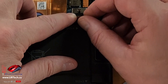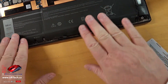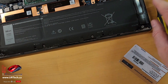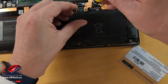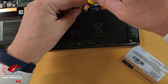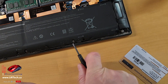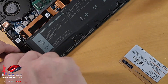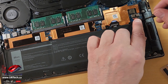Now let's plug this connector in. Make sure that's down everywhere. Put the tape on next. Make sure that ribbon is not over top of this — it needs to be on the side. Start popping the screws back in. If you ever drop a screw inside a chassis like this, don't panic — just tip it upside down and tap it out. Be careful not to put the back screws in the wrong place. Now just before you're done, go around and torque these down again to make sure that everything's tight.